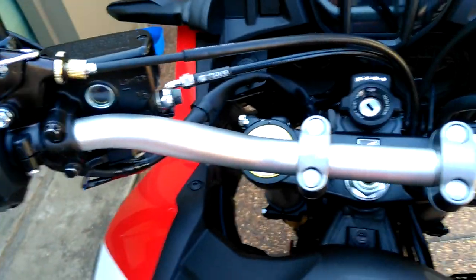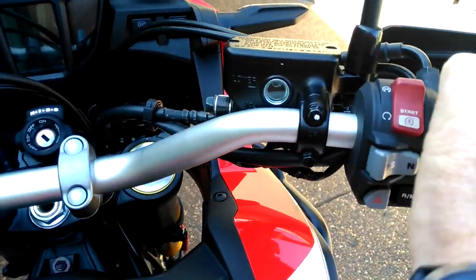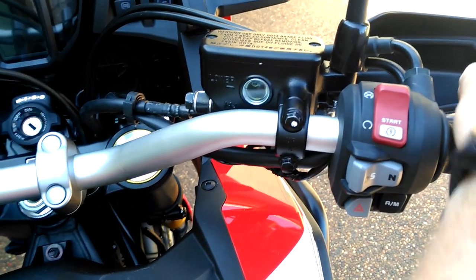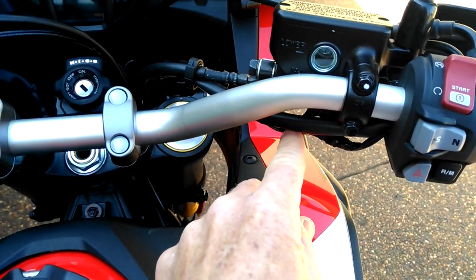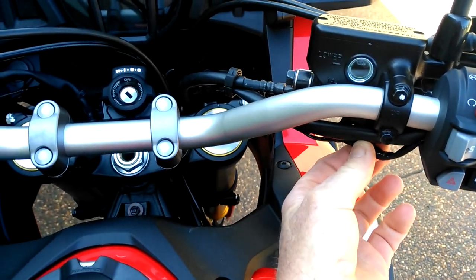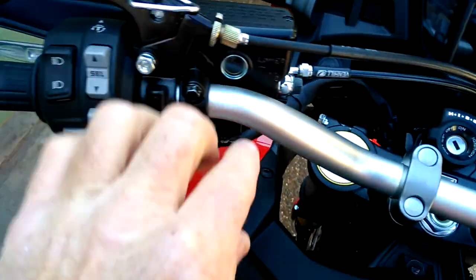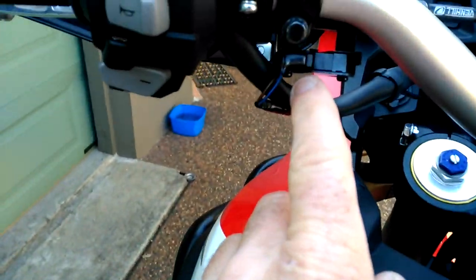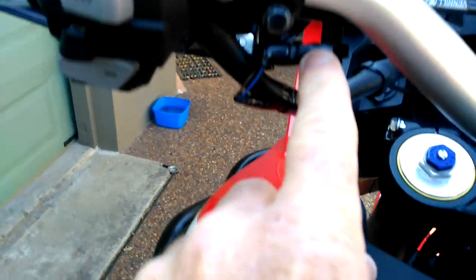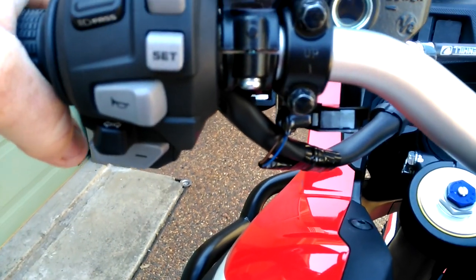For the wiring: the wiring that comes down from the front brake to power up the rear brake light comes down through under here. All you do is tap into that wiring, run the wire down over the front, come up this side, and connect it onto the switch here. That's it — so when you activate it, it powers up the rear brake light.